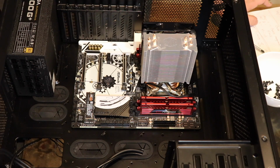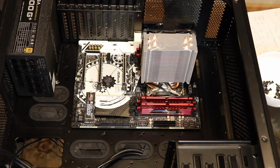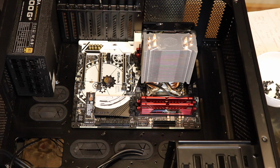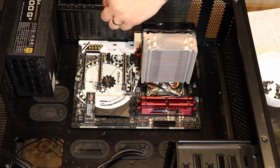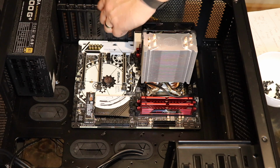Okay. So we've put the motherboard in, we've put this in. Now we're going to go ahead and put in the graphics card. Usually along the back you have a lot of these little doors, right? And you just unscrew some of these doors. They're sort of like dust shields almost. And they lift right out of the case.